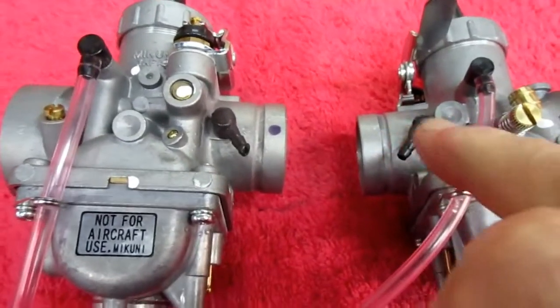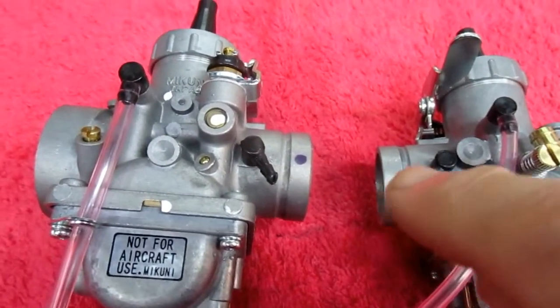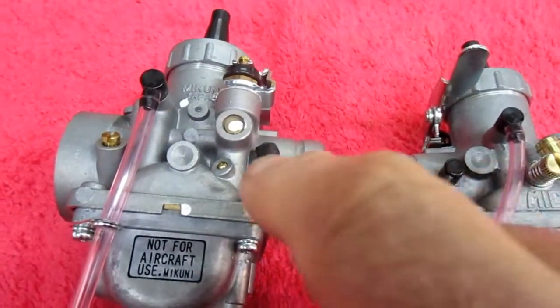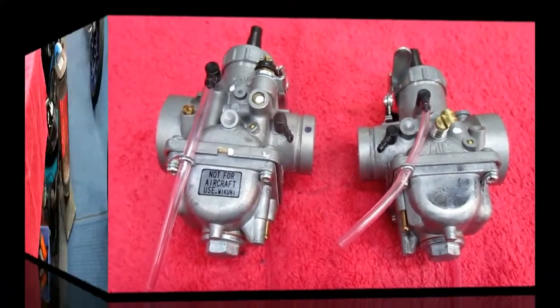So that's probably the most difficult part of the job, getting precision fits that are press and airtight. And at the end of it, I've blown WD-40 through those little passageways to make sure there are no little chips or anything in it. So we're basically ready to put the carbs back on the bike.